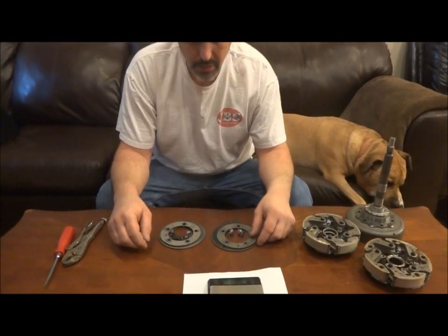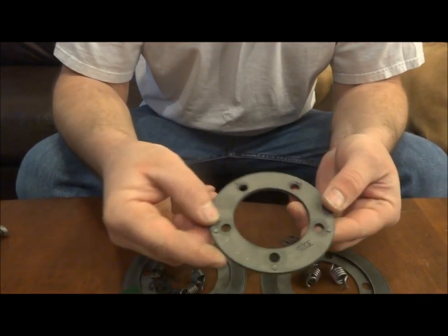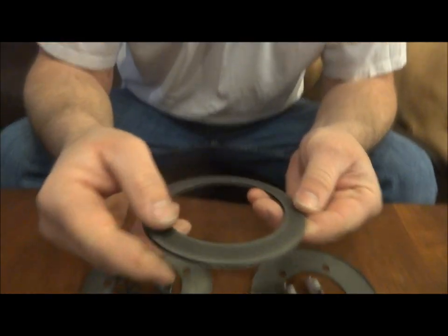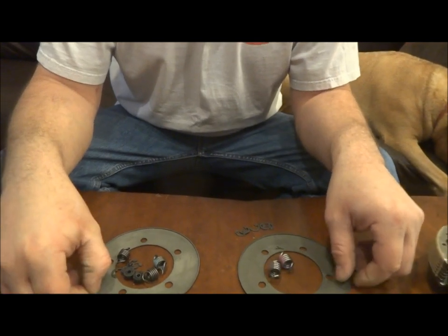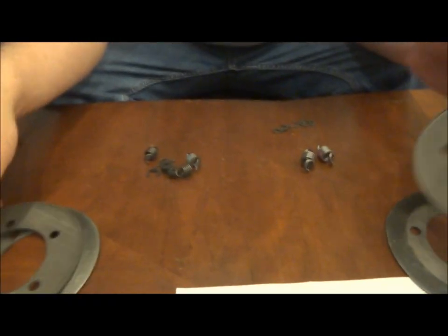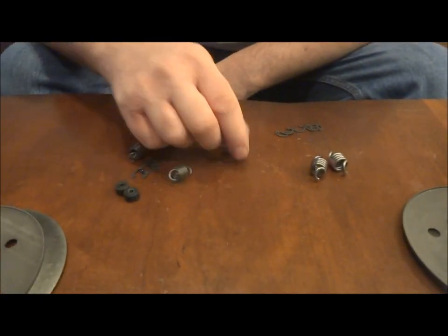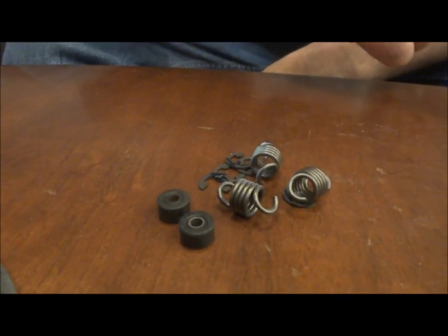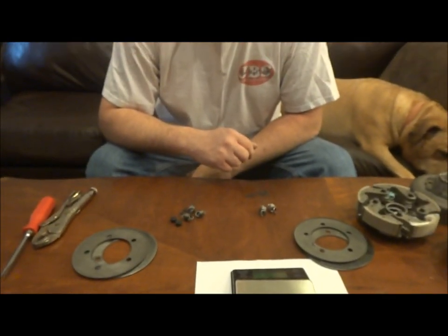Let me show you something else on these Yamaha and Kawasaki pieces — they are identical, exactly the same piece. You can lay them right on top of each other, they are identical. So there's the back plate, all the holes — this plate will fit on the other one. They're pretty much the same exact clutch except for those rubber bushings and the springs, which are a lot weaker. I think once these bushings are taken out, they'll be a lot smoother on engagement and disengagement. You'll notice a difference when coming to a stop and changing gears — should be an improvement on gear changes too.